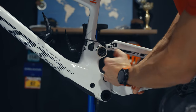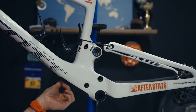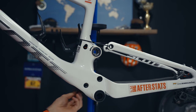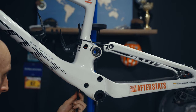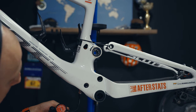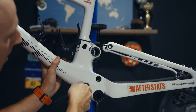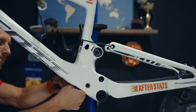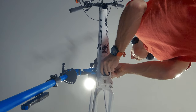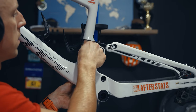There are spacers on each of the bottom sides and also an additional metal one on the drive side. What's remaining is removing the rear shock. I'm not exactly sure whether I should remove the air before removal, but I could see it moved down a bit when I removed the air, and I thought it might cause a bit less stress if it's not pressurized. Unscrewing those bolts made the shock drop down, giving access to the top bolt. You also have to remove the cable in order to remove the shock.